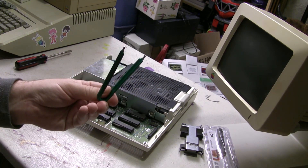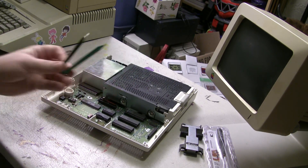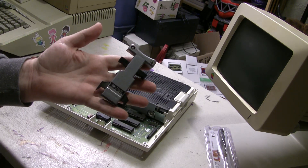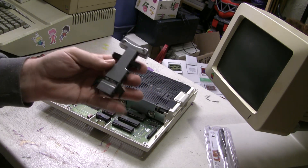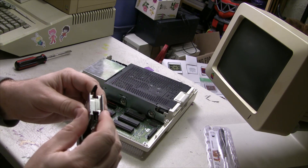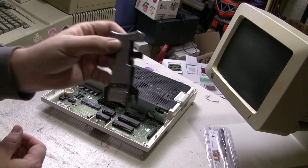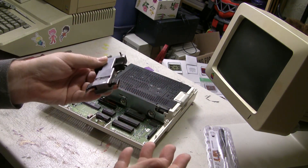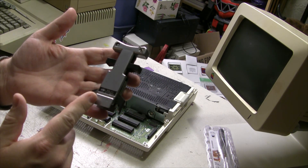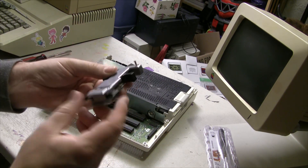These solutions are okay, but there are maybe some better ones out there as well — if you catch people snoozing on their eBay auction, you might be able to get a decent price. And this is one such device: this is the EX2. I've seen Adrian Black and different people use it, and I'm pretty sure Chris has used one in his videos too. Basically this is a DIP extractor, but it's designed to take a lot of the pressure off the sides of the chip and convert that force into something that will protect it. If you buy these brand new, they might be $35 or $40. I got this one at an electronic supply house going out of business on eBay — I ended up paying like $14 shipped.